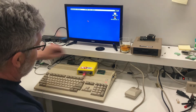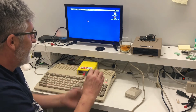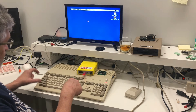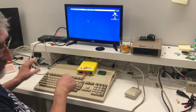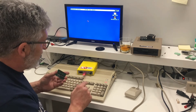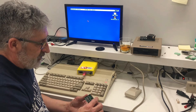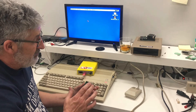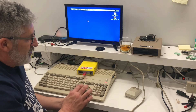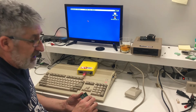What we've got is this little adapter. It does the same thing — it swaps the drives — but without any switches. It's a switchless swapper. To invoke it, you just do the reset three times: Control-Amiga-Amiga, reset, reset, reset, and it swaps the drives for you. It's designed so that there's no chance of shorting out those two pins you're swapping. It can also be programmed so that your external drive is your main boot drive, or so that the internal remains your boot device.